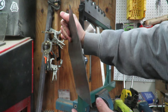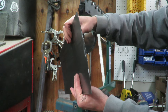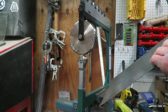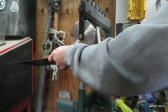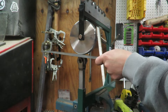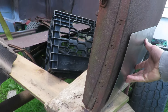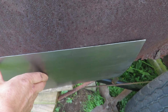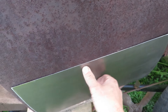It's starting to get like a slight curve in there. What I did on the last one is I just kept on taking it out to the car, seeing how close it was to the panel that's already out there. I'm going to roll it just a little bit more. Taking this and putting it up on the side of the car it matches fairly well with that profile, but up on top it does not — it comes off the back side of it a little bit. So I'm actually going to go ahead and on the back side start curving it a little bit right in here.